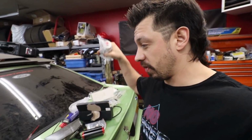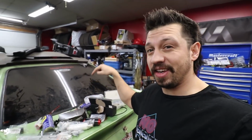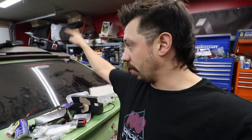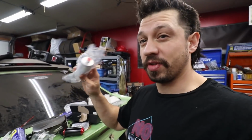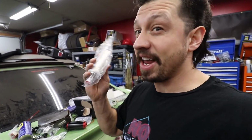I do have a 255 here, which is supposed to be our lift pump for this car. So essentially we're gonna run the Walbro pump external from the tank in this car, and you just feed the fuel up to the front because there's gonna be a surge tank with 2 pumps inside of it. But I'm gonna steal this for now. This is super overkill, and I have a feeling like our stator wouldn't keep up with this anyways.